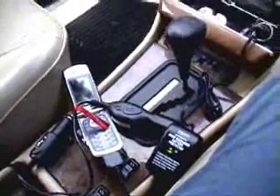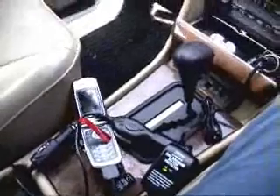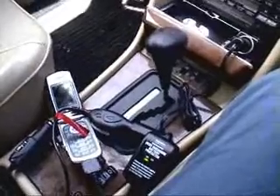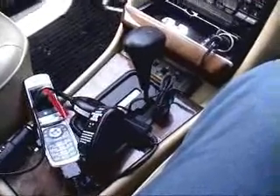On power, little things like your mobile phone or sat nav barely use any power at all. You can run them for hours and hours on end before they even threaten your battery. So, not a hassle. If you've got things like televisions or DVD players, you want an over-discharge protector device. Flattening your battery is going to cost you a small fortune, so you really want to take care of your battery — it's a real big inconvenience if your battery does go flat.